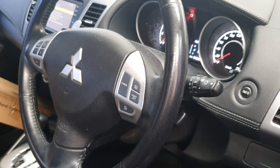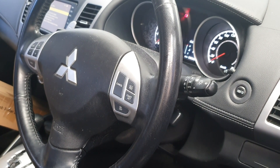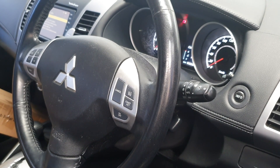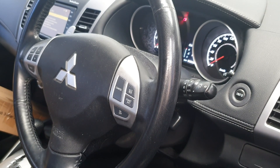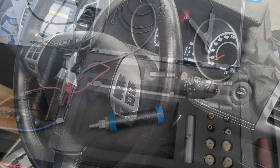This car has already been diagnosed — it does have a restricted exhaust, it's got a blocked cat. What we're going to do is set up the Ditex PDS 500G. I'll show you the kit first, then we'll get it on the car, set it up on Pico, run it up and see what readings we get.